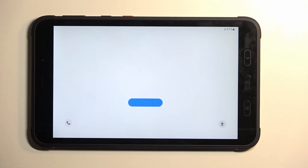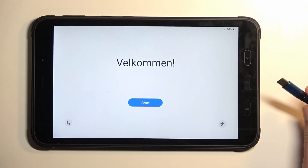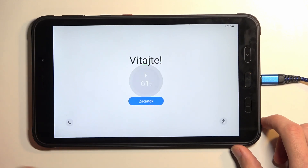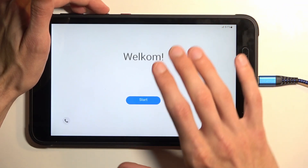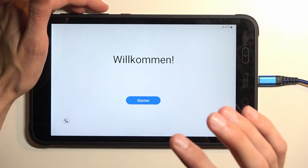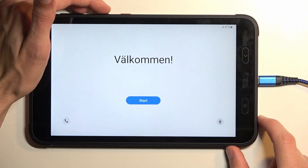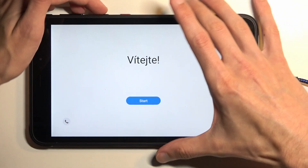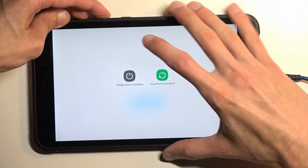The reason it is problematic is because we can just grab a cable — we will need a cable regardless, because that's how we boot into recovery mode. With that in mind, we're going to plug it in right away. What you need to do is hold the power button and volume down, and you're going to hold it for longer — as long as it takes for the device to actually turn off. These two buttons are kind of like a shortcut for force restarting a device, similar to a reset button on a computer.